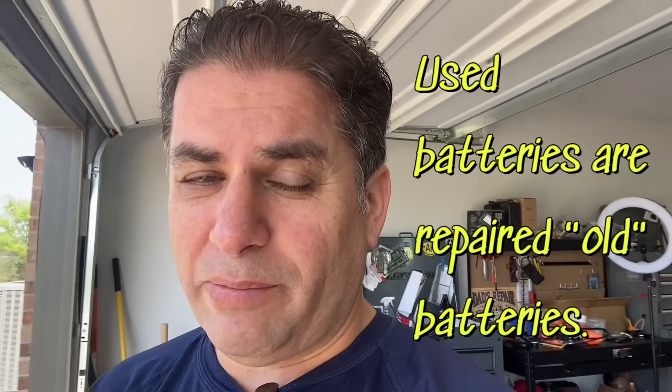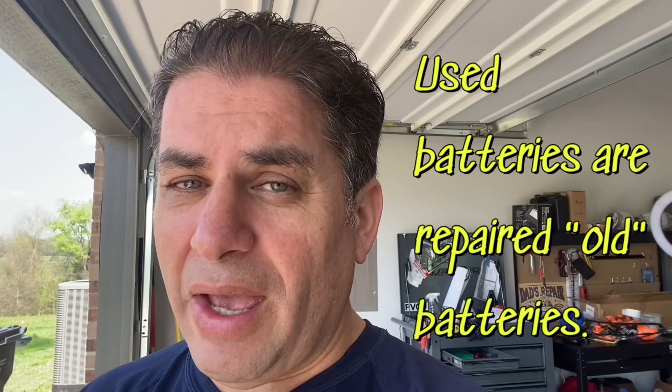Repairing an old battery is a waste of time. I used to run a car dealership and tried used batteries for about two years — I've never gotten so many complaints from customers, and 99% of them were battery-related. After figuring this out, I never put another used battery in any vehicle. If I hadn't load tested this battery, I would have replaced the EVAP system component, which alone was over $200 — more expensive than the battery itself — and it wouldn't have fixed the real issue.